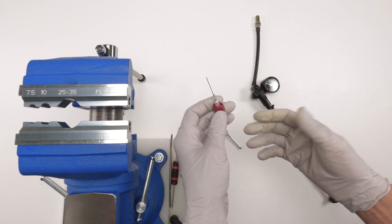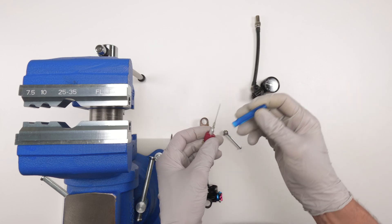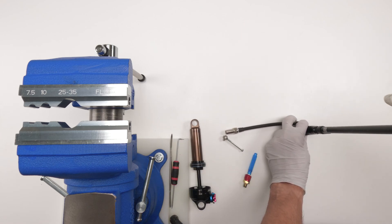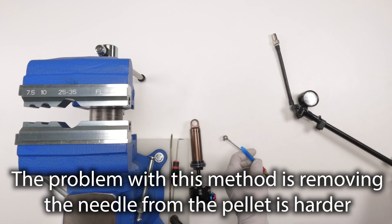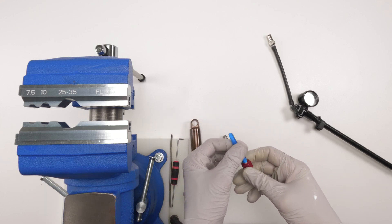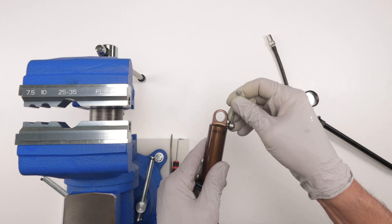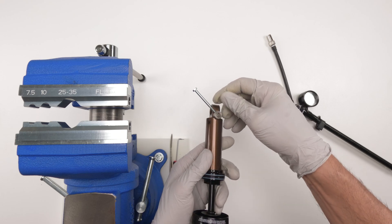It will work but you take a much bigger chance of breaking the needle. Your other option is to do it on the ground and use the table as leverage. Connect everything together and just push up and down on the table. Trust me, it is way easier to get to 500 psi and the pump will barely move, putting less strain on the needle base. So that's how I'm going to do it here. To start, we're going to take our tool — whether you make your own or use Fox's — and make sure our bleed port is completely shut.